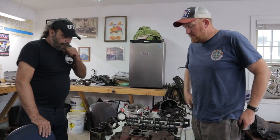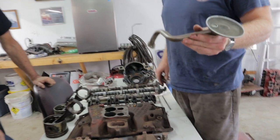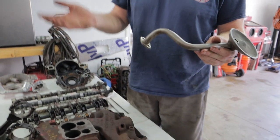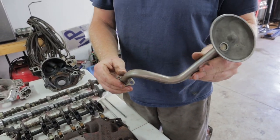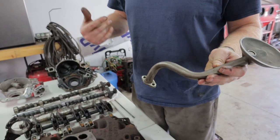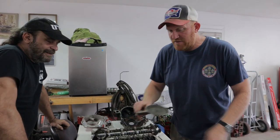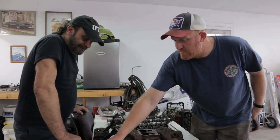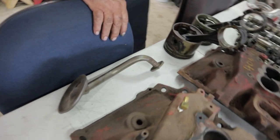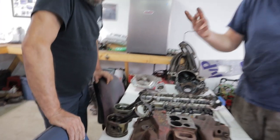Here is your oil pickup for the '70 Grand Sport Stage 1 and later big block. The diameter of the tube is considerably larger than the earlier one. I usually just throw the earlier ones away when I get them — they could barely move enough oil to keep the engine oiled. These later ones can be retrofitted; this one is actually a TA Performance replacement. All you do is drill the block out and bolt it on.